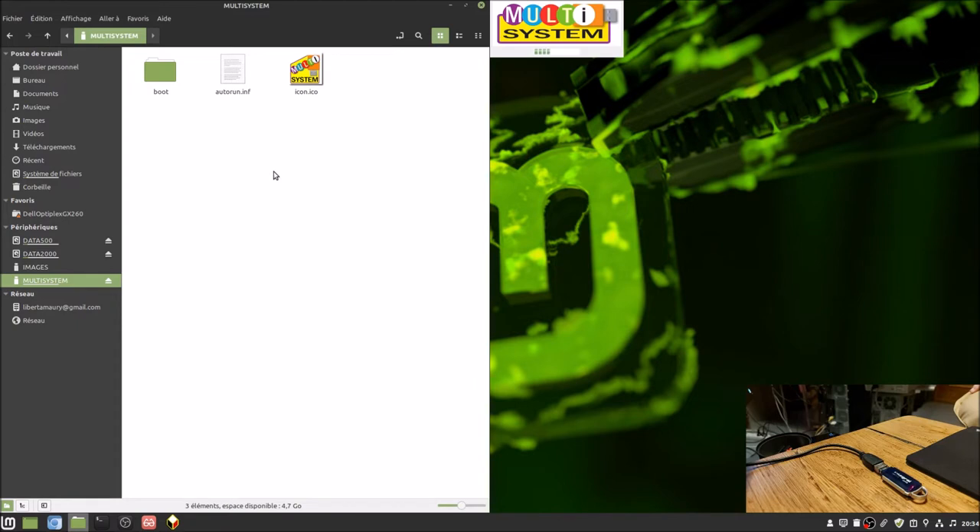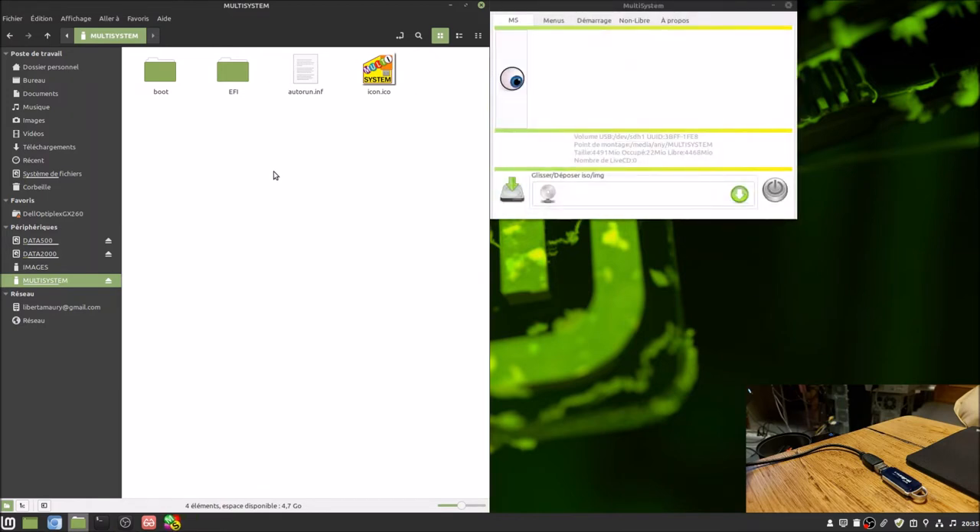We can see activity on the FAT32 partition. Second step: we need a CloneZilla ISO image. There is a CloneZilla image for 32-bit architecture and one for 64-bit. Which to choose? It's simple — in the documentation it's mentioned. If the computer is from after 2003, you are in 64-bit. Use the CloneZilla 64-bit architecture image. There is a 95% or greater chance you are using a computer from after 2003, so you can use the 64-bit CloneZilla image.